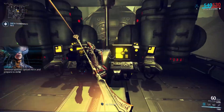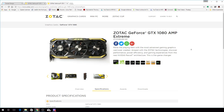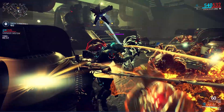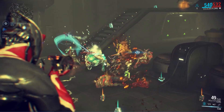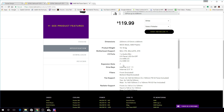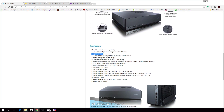But we're not done with the case. Even if your GPU fits lengthwise, it might be too thick. Let's use Zotac's GTX 1080 cards again. The Amp Extreme is one big GPU — it takes up 2.5 slots in your case. Slots are these things, usually located at the back of your case. It takes up 2.5 slots, which you can basically round up to 3, because you can't just remove half a slot cover. So check your case manufacturer's website and find out how many expansion slots it has. For example, the NZXT H440 has 7 slots, so this huge GPU would fit in there. But something smaller, like the Node 202 again, only has 2 expansion slots, so the card would be too big for that case.